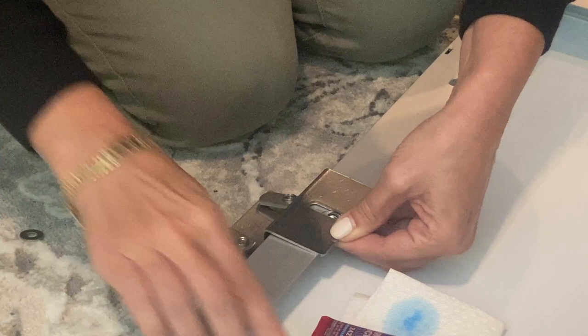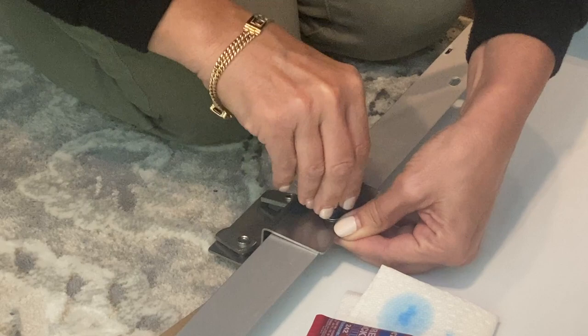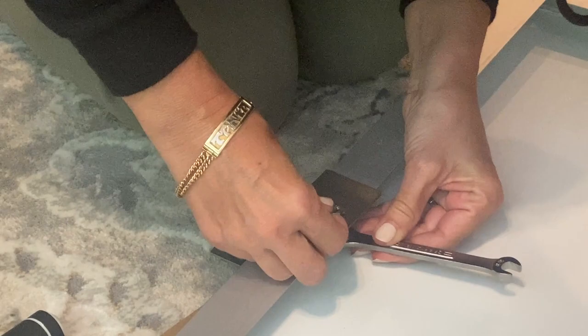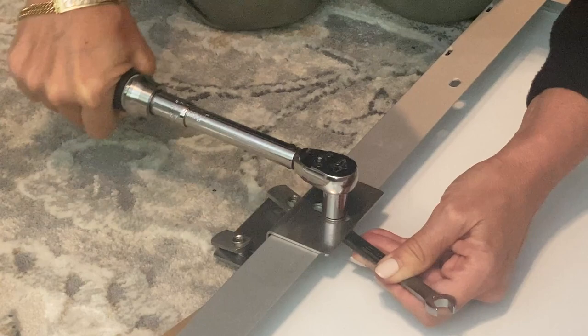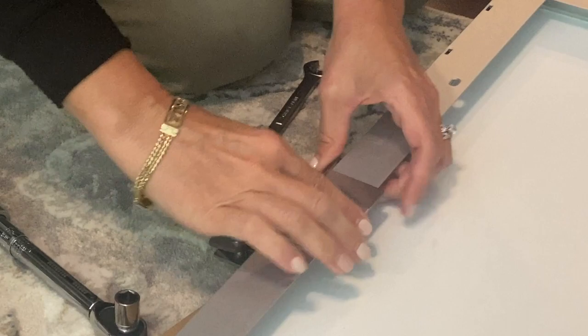Take the other steel bolt, put a little bit of that on there. Oh, I need my washer. So washer goes on there on the bolt. And then we're gonna screw it in by hand like that. Okay. Perfect. We're going to hold it up underneath, and now we're going to tighten this. Okay. Again, making sure that this flush mount bracket is flush to the solar panel frame. And it's looking good, nice and tight. So let's move on to the next one.